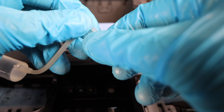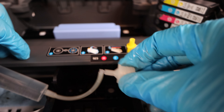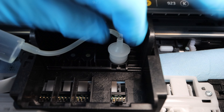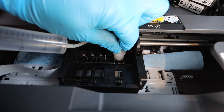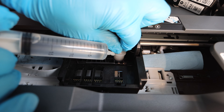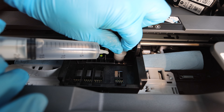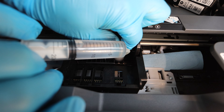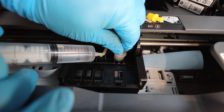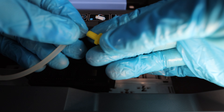First, use the larger clear plastic piece — this is for the black nozzle. If you're not having trouble with your black ink nozzle, you won't need this attachment. Before attaching any attachments, fill up the syringe with cleaning fluid first, because it's very hard to draw in solution once the attachment is already on. Fill it all the way to 20 milliliters or more, then push at least 10 milliliters at a time per color. You have 100 milliliters to work with, so push 10 at a time per nozzle.